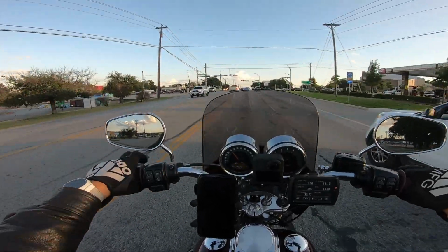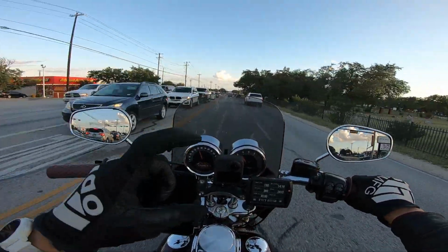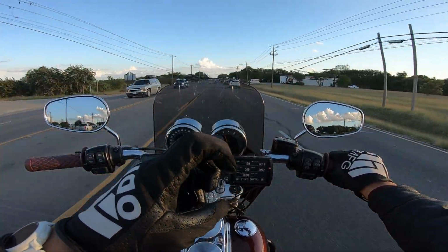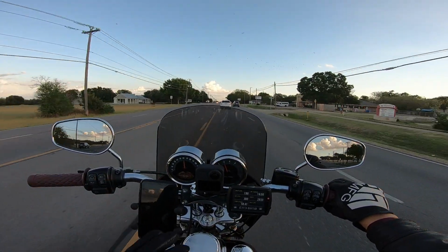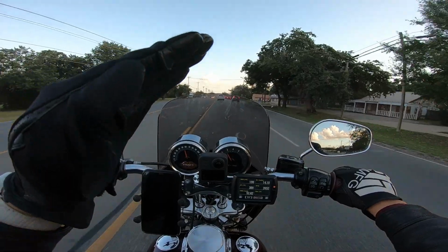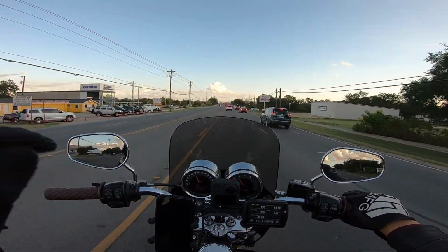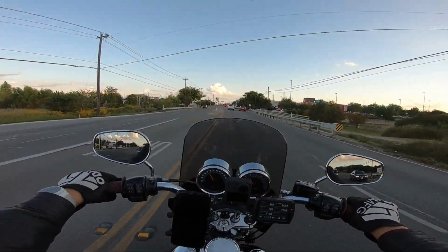And I was reminded of that issue last night because I was swapping from the MK1 adapter where it lifts up your foot pegs, so that if you're going to track, you have the added clearance of that inch. We were removing that so that we could be a little bit more comfortable, and because the other thing is that the brake lever sits far too low from my foot. Instead of my foot depressing it where the brake gets actuated, it would be level, so when I depressed the brake, my foot was going down, and it made for a very awkward movement that didn't feel good, and I wasn't able to get a good purchase or a good rear brake that I thought was super sketchy.